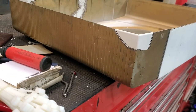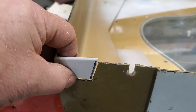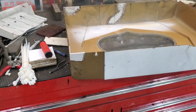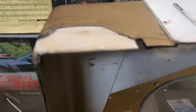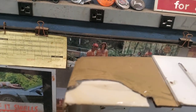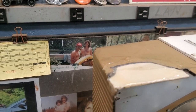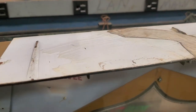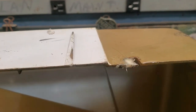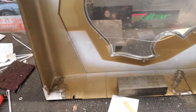I've got this corner piece fabricated — it's going to look pretty good once I get it in. It's getting there. Now what I've done is I've got the double bubble epoxy out. I've come in from the other side. I'm basically just using it like a filler, filling in the cracks, trying to level it a little bit so that when I go to paint it you're not going to be seeing these jagged ridges. This isn't the fast drying stuff, so I'm going to probably let this set up overnight and then come back and hit the other side.